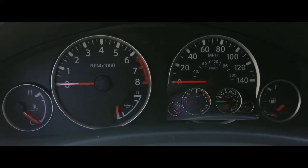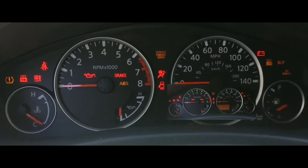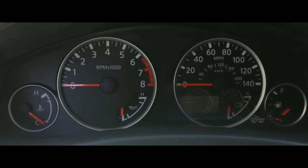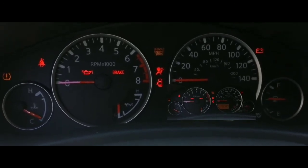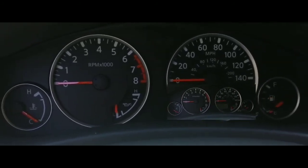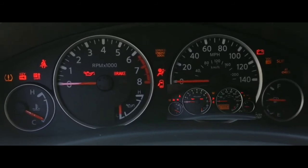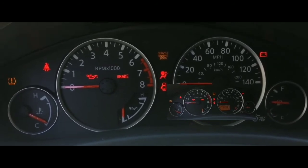It's not the battery — I could rule that out. Could it be the alternator? I ruled that out immediately because my car was parked and completely off before I tried to start it. The other test for the alternator: if you put any power to the battery the car would start up, but once you take the cables off it would die out. That didn't happen here, so I can rule out the alternator.